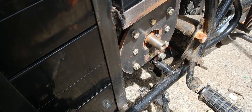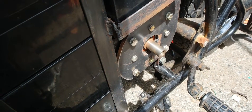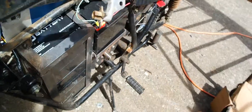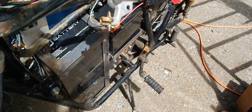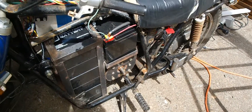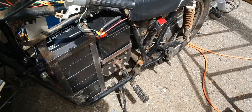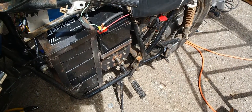Give you guys a little throttle here. This motor's got a top RPM rated speed of 3500 RPM at 48 volts. I'm planning on gearing this with a 10-tooth sprocket for the drive and then just leaving the 40-tooth on the rear, which should give me a top speed of probably around 60 miles an hour based on my gearing calculations — that's just kind of an approximate though.